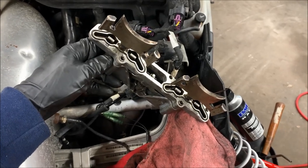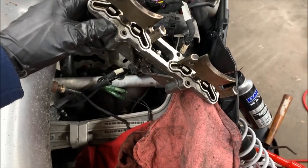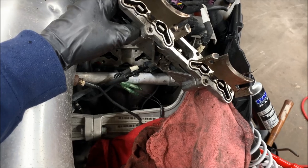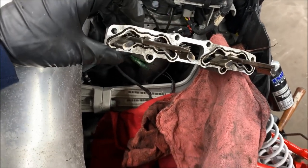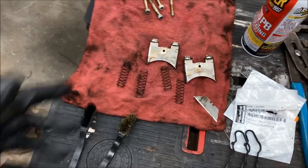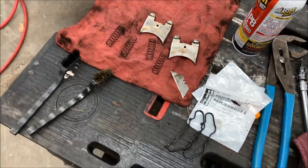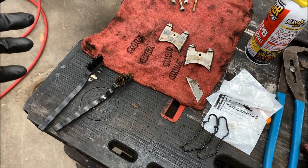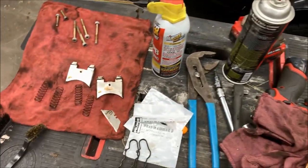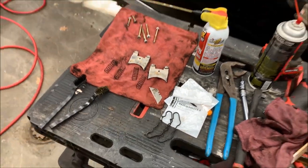For about the past hour I've been cleaning the exhaust valve assembly in the sled — I'll be perfectly honest with you, it's not the most fun job because you're limited as far as what you can do; every time you want to position the thing it's kind of flopping around. But we made the best of it. I got new seals on the sealing block, and I did manage to run the blades and springs through the ultrasonic cleaner so those came up pretty good. As far as cleaning tools, all I used was some plastic and brass brushes, brake cleaner, WD-40, PB Blaster, and lots of rags to break down the carbon on it.